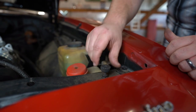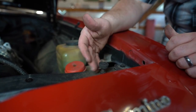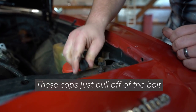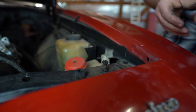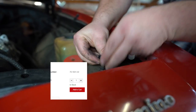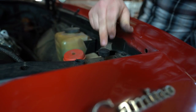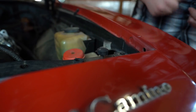First up are these adjustable hood bumpers. These are one of the easiest parts to do, as well as one of the first parts people see whenever you lift up your hood. This one is just a cap that comes off the bolt. You can see how degraded that rubber is, and the new bumpers go on just the same way — it's a cap. If you need a replacement bolt, we have those available as well. We also have bumpers where they're vulcanized onto the bolt so they're one piece. Just that simple — that's all done.